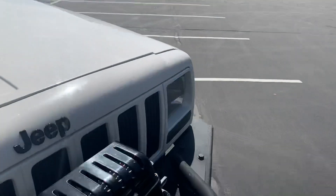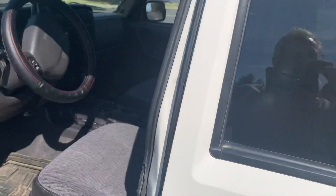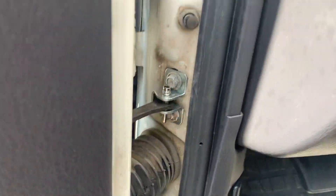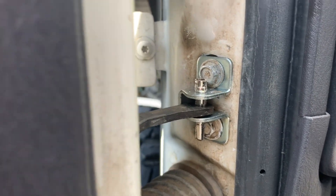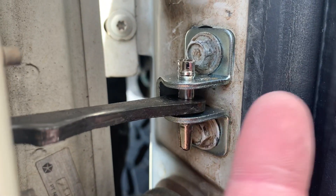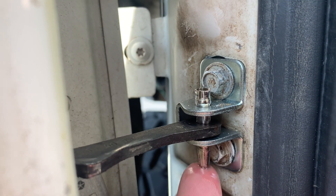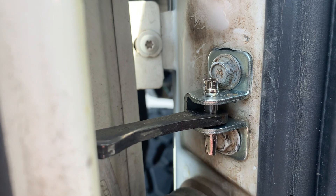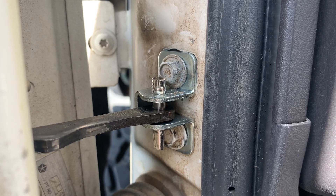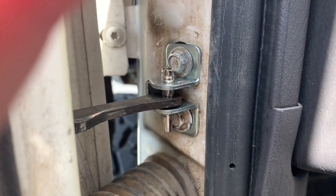You might wonder how I get my doors so quiet when opening. XJs tend to have a lot of noise when you open them, but mine is really quiet. The trick is I bought brand new brackets and pins. Those pins break off and fray. I put a little WD-40 on there to keep them safe, firm, and quiet — that's what helps keep your door from closing with a loud snap versus quietly.